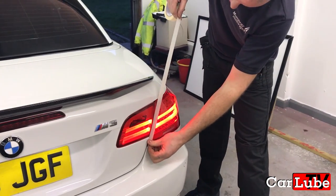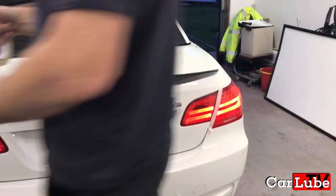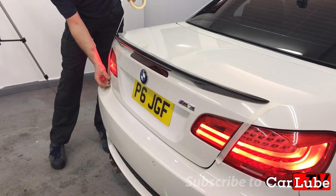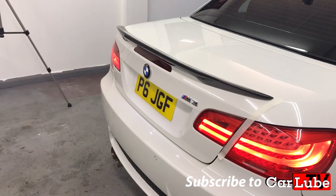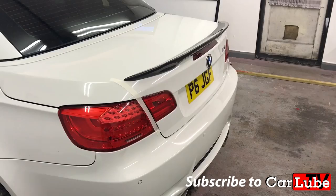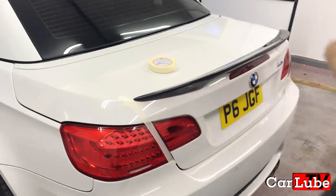To overcome this disadvantage, we run a line of masking tape up the rear of the car and over the boot. The masking tape is a very good idea on any install as a marker, because once you place a spoiler on the boot lid the 3M tape grabs quite hard and doesn't allow for repositioning if you've placed it in the wrong place.